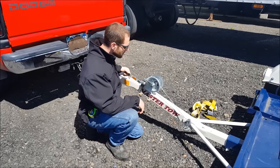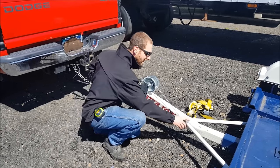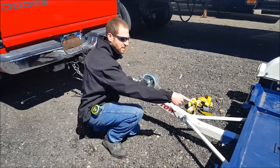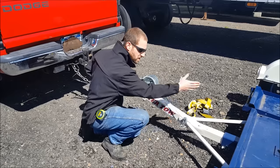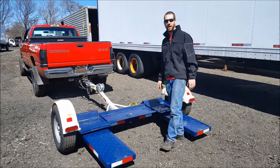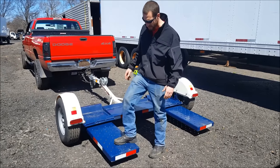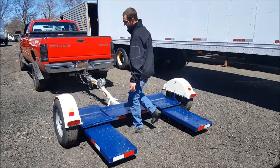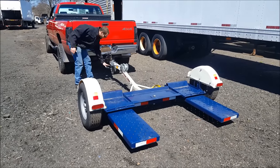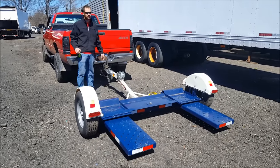On this one I have the optional winch, which is really great for winching vehicles on that do not run. Just make sure after you've tied your vehicle down to unhook this, because otherwise when you take turns and this deck turns, this strap's going to be scraping up the bottom of the bumper causing a lot of noise and damage. Unlike a U-Haul and other tow dollies I've seen, these ramps are fixed and stay right here. So the problem with that is your hitch is going to have to be set at a certain height — if your hitch is up too high, those ramps are going to drag on the ground.